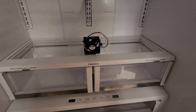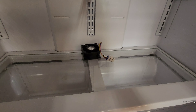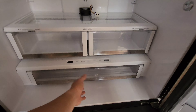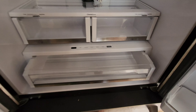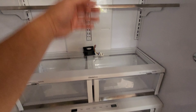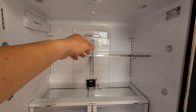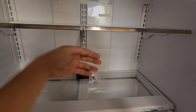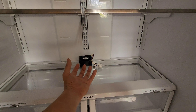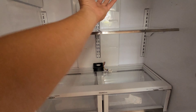The fan unit is a fail which is located underneath here. The symptom is very cold bottom fresh produce tray — it all freezes up, ices up underneath — and there's very high temperature on the top of the unit because the fan is not blowing cold air from the bottom.